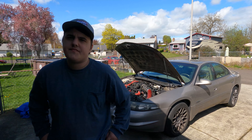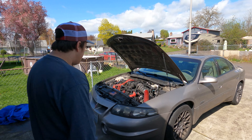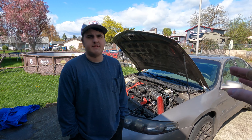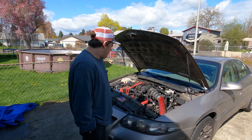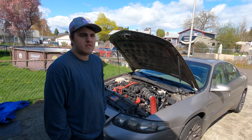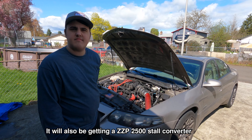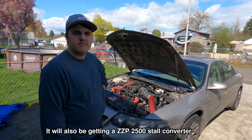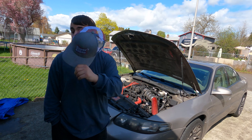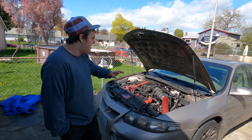The transmission we're putting in — that's going to get rebuilt — it's going to have a Quaife LSD. If you know anything about these front-wheel-drive 4T65s, it's like the best limited slip differential you can get for these. Very expensive. It's going to have a 4340 input shaft, the 329 gear ratio change for the chains, the 7/8-inch single chain versus a double chain, upgraded valve body, and the shift kit stuff from Transgo. A lot of beef stuff. Everything is covered in our previous video.